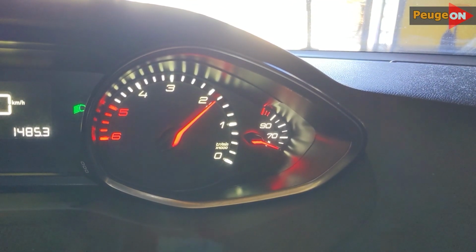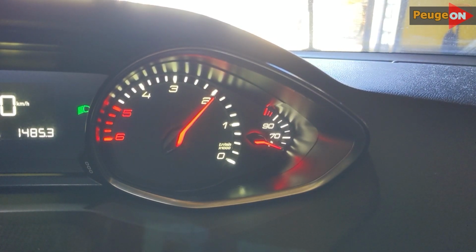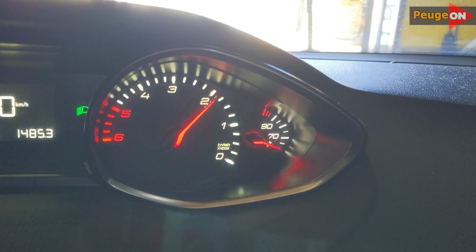If you set the fan to maximum, a lot of heat will be taken from the heater radiator, and we don't need that. On the contrary, we need all the heat to stay in the engine. Now we wait until the car warms up to about 82-83 degrees and the thermostat opens. Most likely the fan under the hood will start working, but that's not certain.